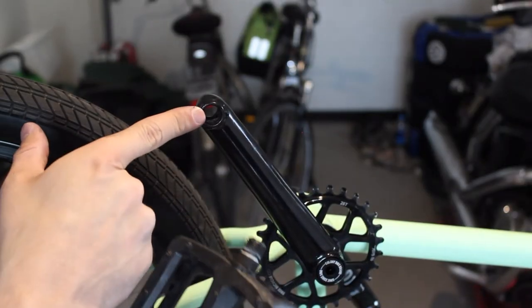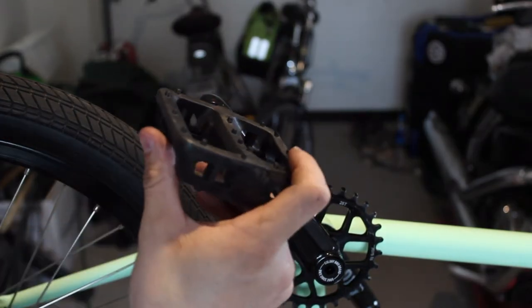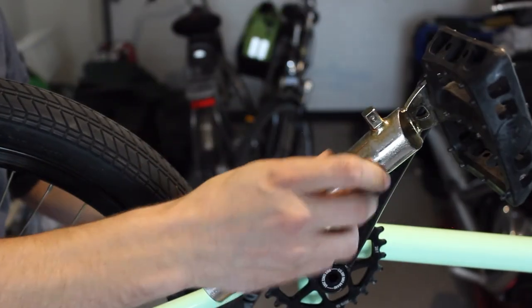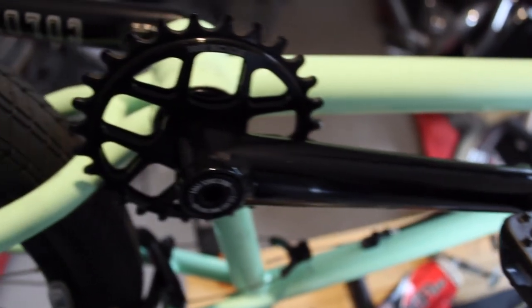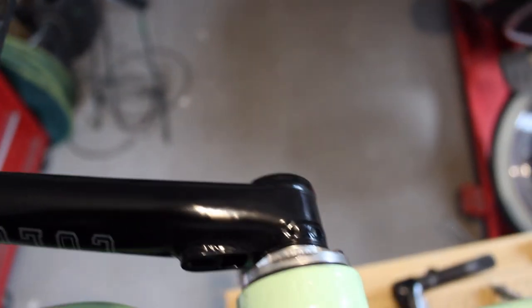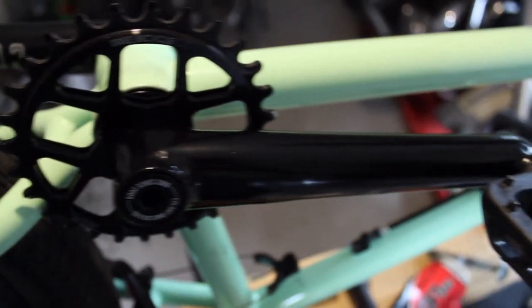Next step would be to put your pedals back in your cranks. Make sure your pedals have a little bit of grease on them as well. The left goes in the left, and the right pedal goes in the right. I know I still need to do the chain, but I didn't bring the tools down here to loosen up my back wheel, so I'll do that in a minute. For those of you wondering why I've replaced my crank because the old one was perfectly fine — it's due to the age of the crank. I believe that if you ride something hard, even though it hasn't broken yet, the longer you ride something, the higher the chance something might break. If you guys have any other suggestions about how-to videos or any questions, leave me a comment down below. Please give me a thumbs up because it really helps these videos, and I hope to see you guys next time.